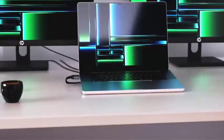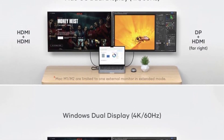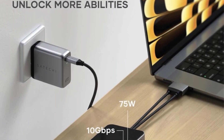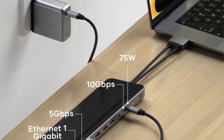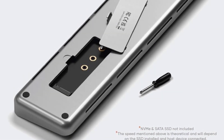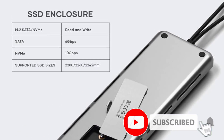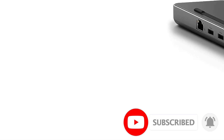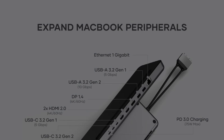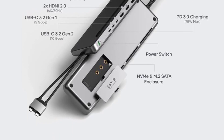Since the Dual Dock works without power, it's a lot easier to set up than other docks with transformer boxes and DC cables. I found it made the most sense to just use the MagSafe connector on the laptop, but you can also supply power to the dock using the non-data USB-C port and it will pass 75 watts to your machine. Both the 4K and HD monitors I tested looked great and worked well in extended mode. There are two USB-Cs for a webcam and mic, plus two USB-As which could be used for a dongle, mouse, and a streaming light — that's likely enough ports for conferencing or even a basic video creator setup. The dock is ultimately limited by the fact that none of the USB-C connections are Thunderbolt and there are only two USB-A sockets, but it's a great choice for extending productivity in a way that tucks beneath a MacBook neatly, moving the cords to the back of the machine and out of the way.